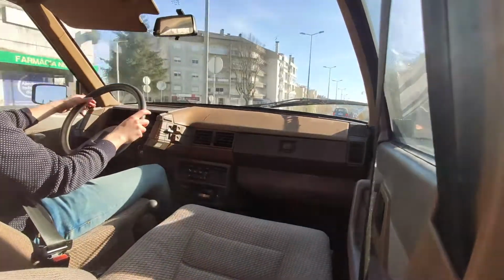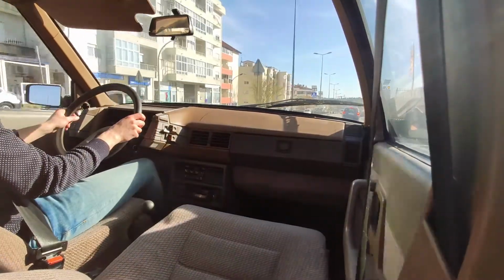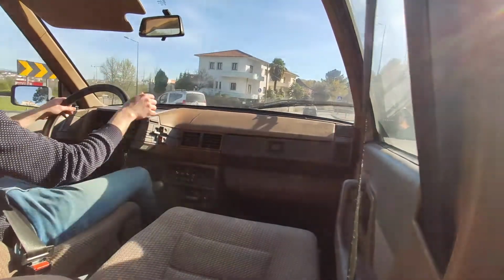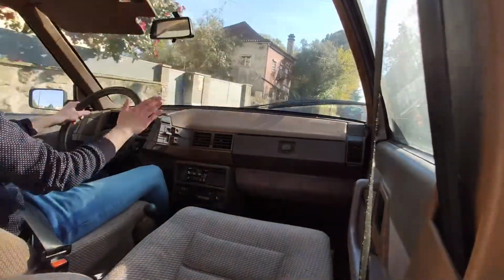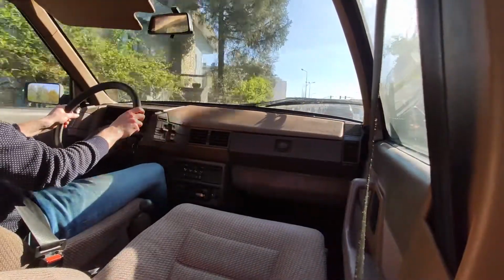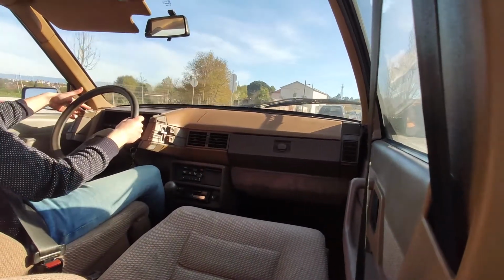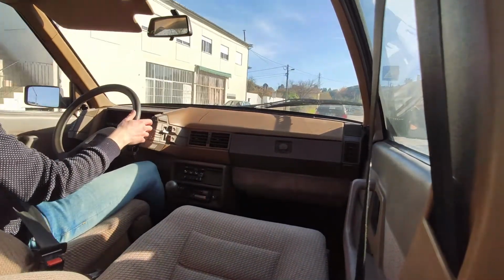It was idling like rubbish, and there was a bit of hesitation. I thought that was all that was wrong with the car. When I tried to use full throttle to maintain speed going uphill, it really wasn't responding, and unless I gave it a little less petrol, it would eventually stall. Now imagine me trying to negotiate two big hills on the way back, when I finally decided no, I couldn't take this car anywhere like that. But eventually I was able to get the car back to the garage, and obviously I complained, and I thought it would be just that gasket.